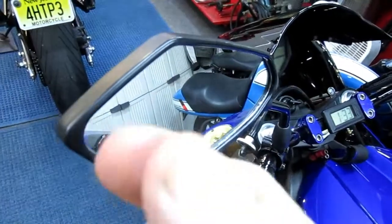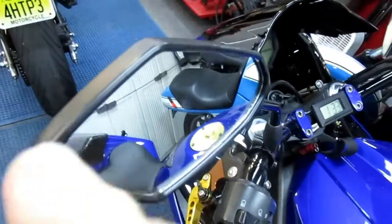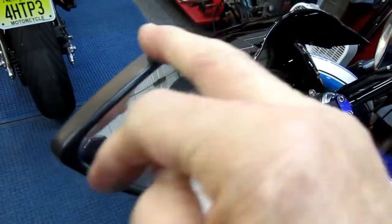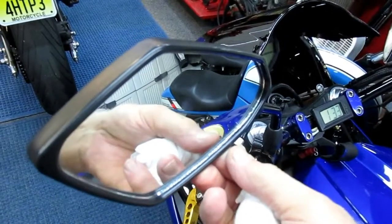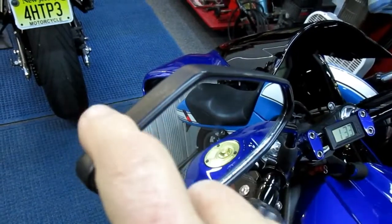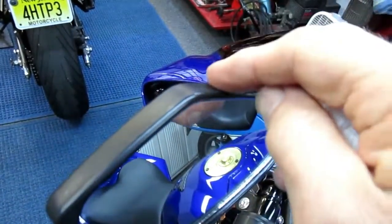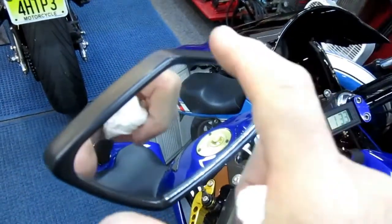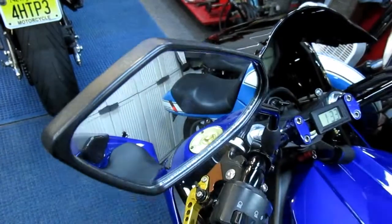These are little things that you learn over the years. I would say this: before anybody paints any plastic parts, do a little test on a part you can't see. One of the things you can do to protect yourself is use primer sealer. Once you scuff this up a little bit, use primer sealer. Not primer, primer sealer, and that'll kind of stack the deck that your plastic parts are not going to melt.